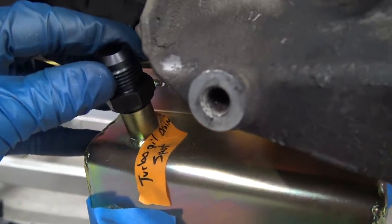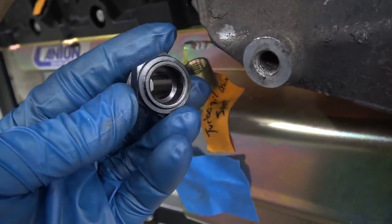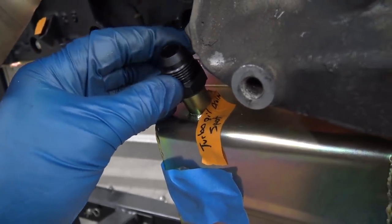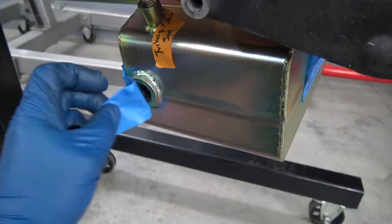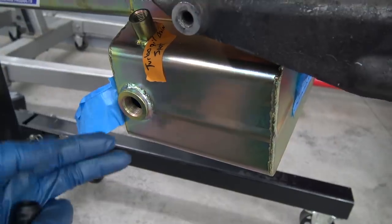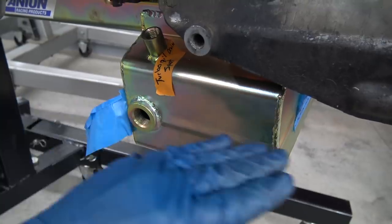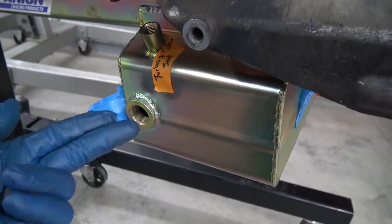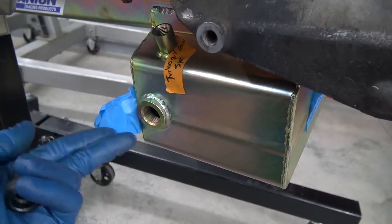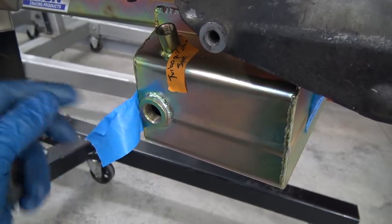Currently it's not sitting on there very well, so I'm going to drill out this fitting just a tiny bit so it'll plug down on there and give us some good flange to weld on. Now you're probably wondering about this spot here — this seems like a perfect location for an oil drain. It's big and it's down low, but this is actually for the LS oil level sensor. Draining oil into the oil level sensor would cause a variety of issues, so as nice as it is, it does not work for an oil drain. We'll plug that up later.